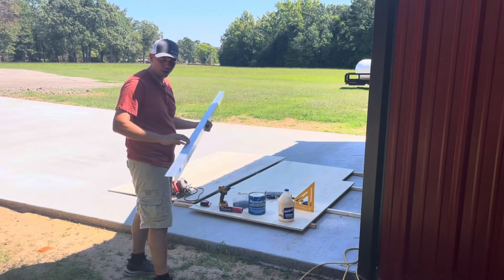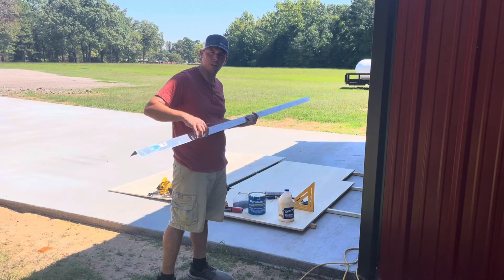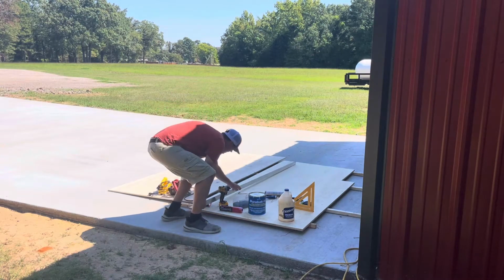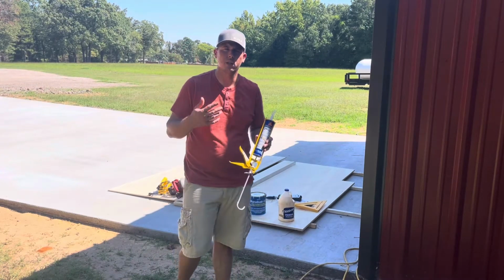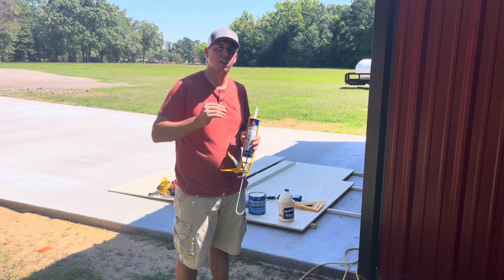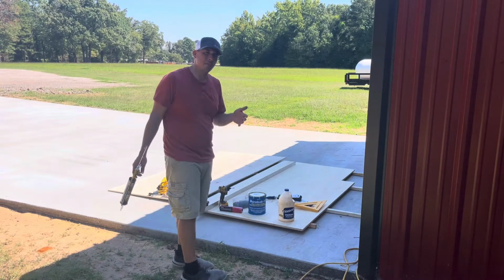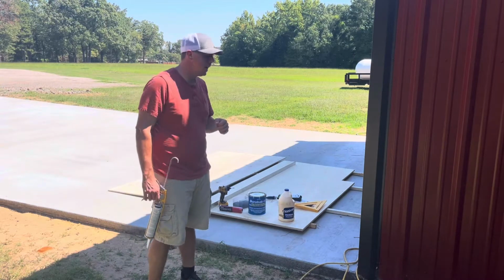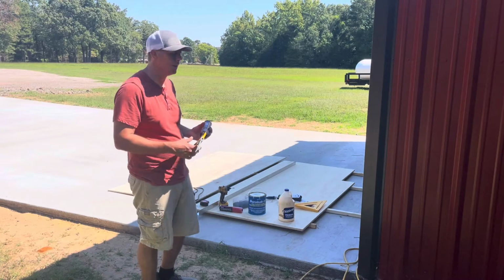Now, we're going to attach it to the sidewall, but we're not going to run any screws from the floor through this to the floor. We're going to attach this using either Sika or ProFlex or something of that nature to attach that aluminum to the new wood on the bottom of the slide. So this is another thing that we needed. We're also going to need a tape measure, a pencil, straight edge, a square, and some other oddball items that may pop up in the video.